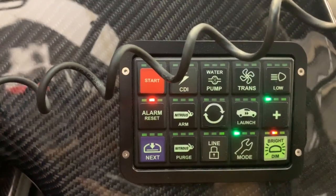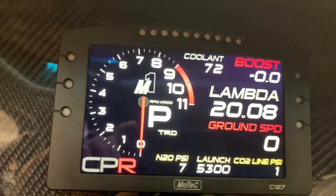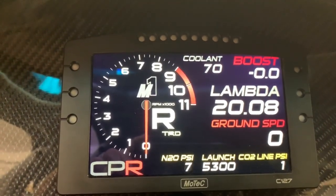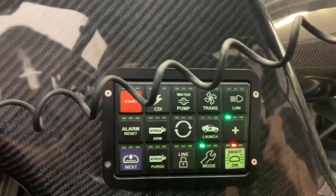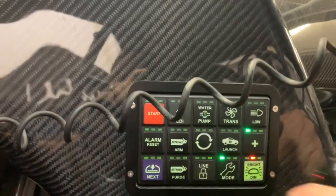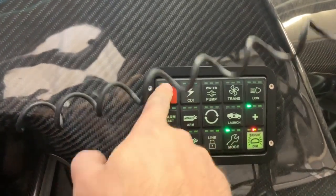One other thing I did: you see this orange light above the alarm — nobody really uses that light for anything, so I wanted to indicate the neutral safety switch was active for a start position. On my trans I have a line pot that shows gear position, so we're in park, we can go to reverse and neutral, back to first, up to second. Right now that orange light is off in second; go back to first, it's off; go forward to neutral and it kicks on — that light is basically our neutral safety switch, so we can pass tech.